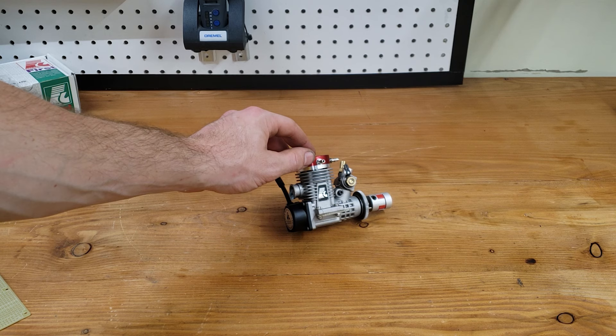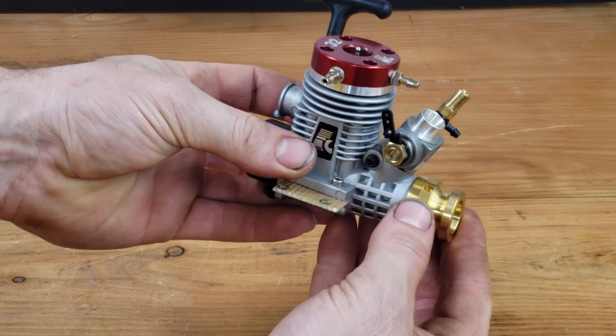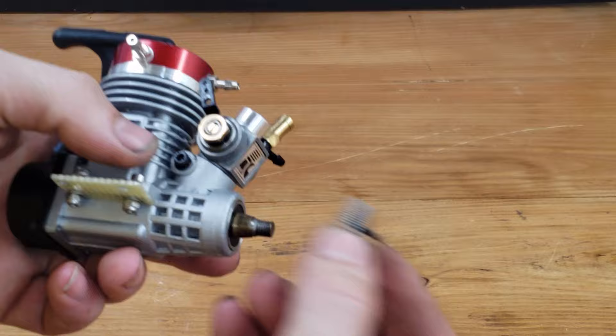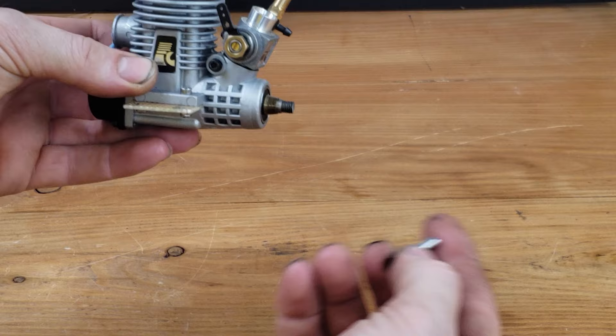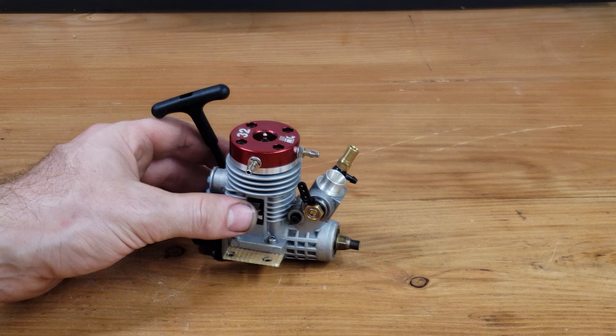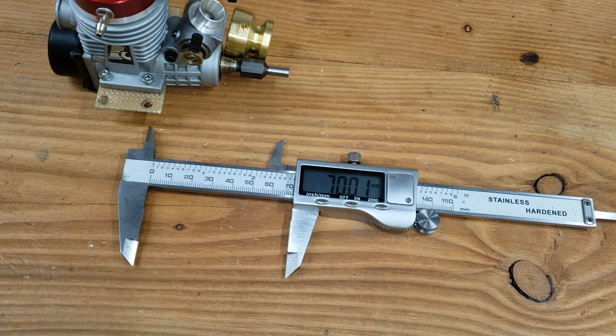Make sure that the four mounting bolts line up straight and are tight. Now we need to talk about the engine. When I got the engine off AliExpress it originally came with a marine flywheel — I wanted to save a bit of weight so I went with the Traxxas aluminum ones. You might notice that the output shaft is not 5 millimeters, but that's not a problem because you can easily get 5mm adapter nuts. Traxxas offers some but I got mine at artatexnomobiles.net. Even with the new part it was still a little bit too long so I had to grind it down on the belt sander. That's why my engine might look a little different from yours.